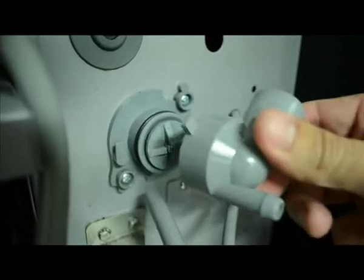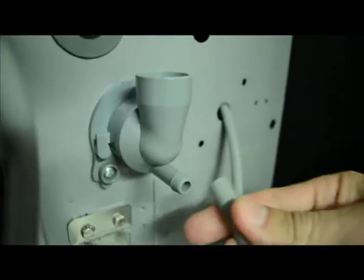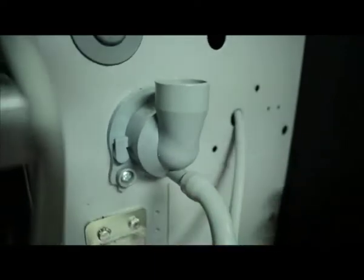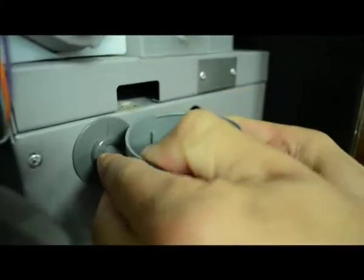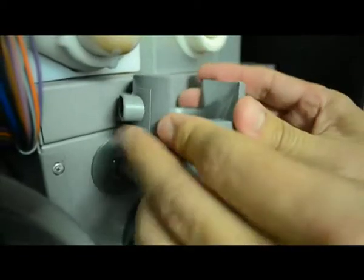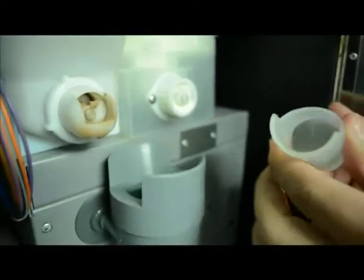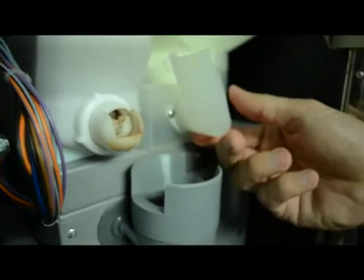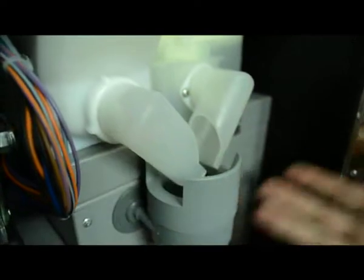For installing the rest of the pieces, we have our section here that just slots into place. Key thing to remember is that the hose just goes back on in front — it just pushes on, not under any pressure so it doesn't need to be screwed on. Then the last two pieces slot into the hole, and the top section of the mixing bowl just slots in place. Always remember to pop the elbows back on — these are probably the two most important pieces to make sure they're dry, as they'll end up with milk powder and chocolate powder in them. Turn the elbows down and you've got a beautifully clean mixing bowl section.